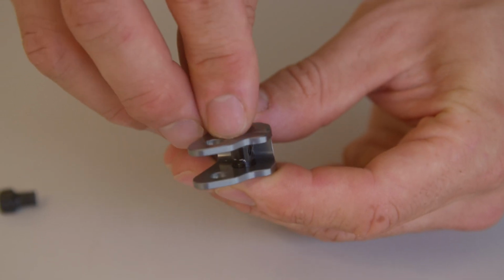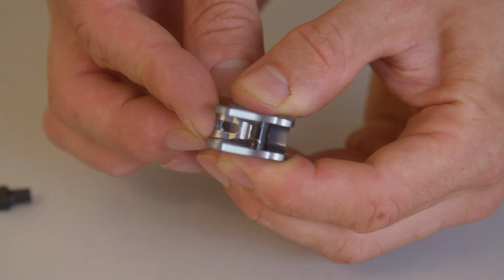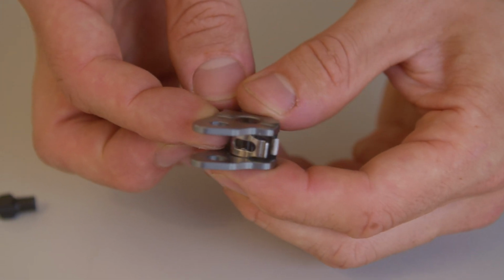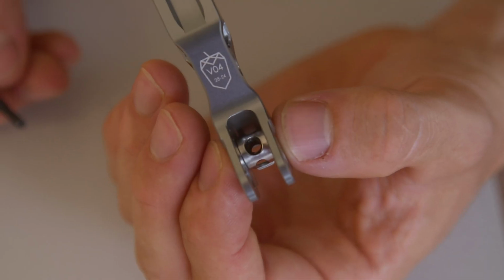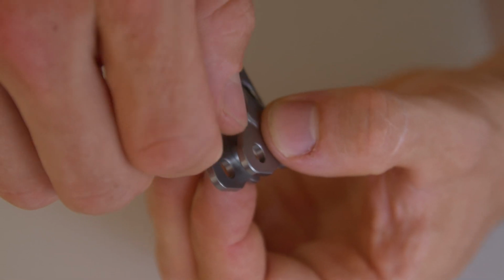Insert the cross nut bolt into the Oak SR brake lever blade. Then snap the flat spring onto the cross nut bolt. Ensure the correct alignment of the components relative to each other. Then screw the threaded rod into the cross nut bolt.